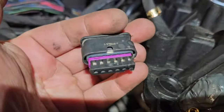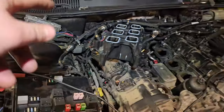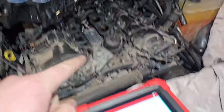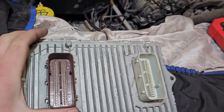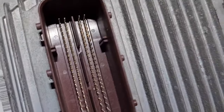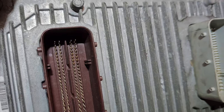When you try to measure the sensor voltage — like in this case, this example from the throttle body — there should be two lines with five volts, but we still have only one line with five volts. The ECU is not letting out five volts to the component. This is just because of a short somewhere. It gives a fault code that there is a short circuit in the five-volt line, and automatically the transistor switches off the port for the sensor — whether it's for the throttle body or the accelerator pedal sensor.